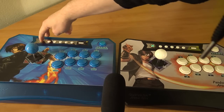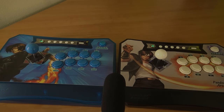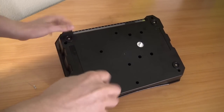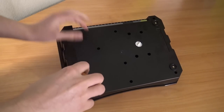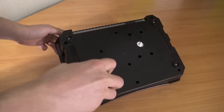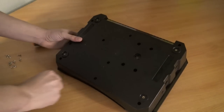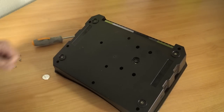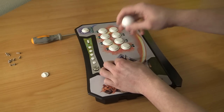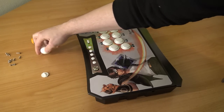They're not the best joysticks but they are okay, and you're going to want to upgrade them if you want to. Let's open it up and remove the four screws. The construction of the joystick is very nice - very thick plastic and I do like the quality they're using. There's a hatch you can open up if you want to remove the ball top or tighten it. When you remove the ball, you can finally lift up the upper part to get into the joystick itself.